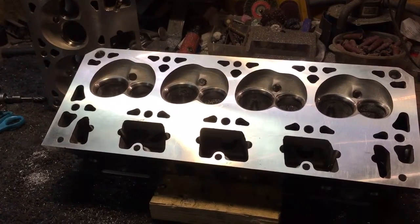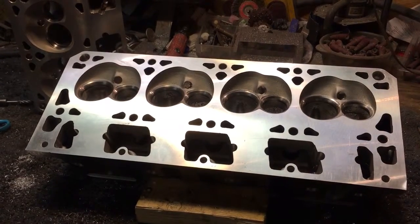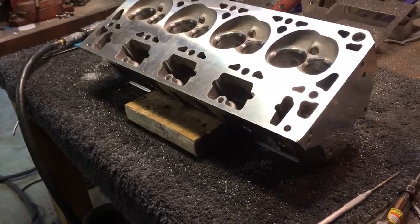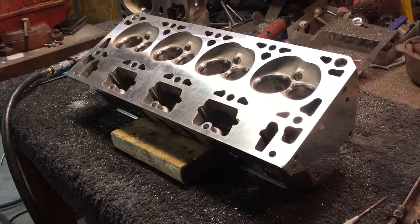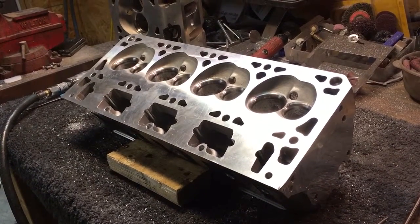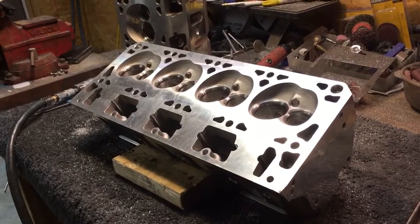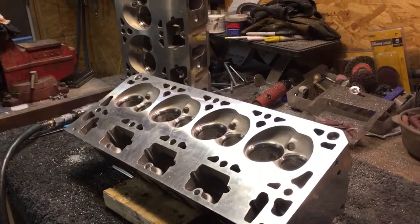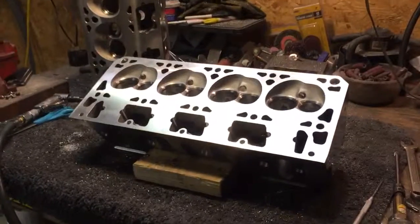Starting out at 217.5 cc, these things — I wouldn't be surprised if they were 219 to 220 cc when I get done, probably 219 to 220 cc. And these things will definitely, from what I've measured and what I know from porting these cylinder heads in the past, easily flow 285 or more. They could very well be pushing close to 300 cfm — I would say 290 plus would be a really safe estimate on these cylinder heads. Because once you get up close to 219 cc on your intake runner with a decent profile, that puts you really close to 285 cfm. Thanks for watching.